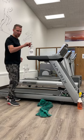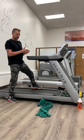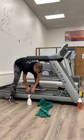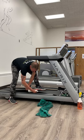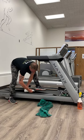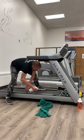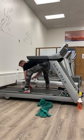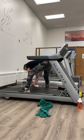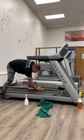This here is a water-based commercial wax that I use — I buy this from Glide Fitness out of the US. It's water-based but it impregnates into the running belt surface underneath and keeps good lubrication so you're not getting too high of a friction, which will ultimately cause higher amp draws out of your motor. I'm aiming towards the middle of the belt on my first pass, and it shoots across.